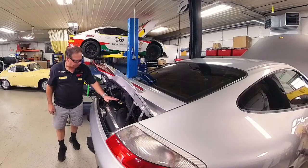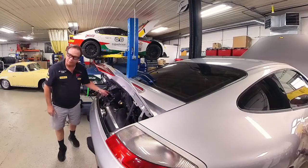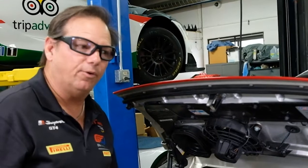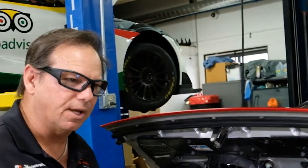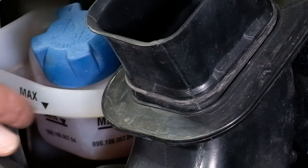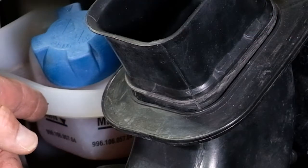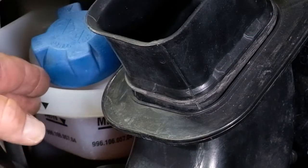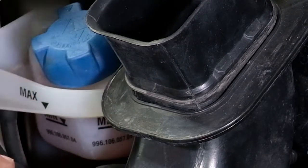When we're talking about plastics — the oil filler, the spark plug tubes, all the rubber and plastic materials — don't forget the cooling system. The water pump impeller is plastic. Do not replace it with a metal impeller because the metal impeller can do damage to the engine by sawing into the engine case. The coolant reservoir is also plastic. You notice how nice and white this one looks? As coolant tanks get older they yellow, and cracks form on the sides. The coolant cap also needs to be in good condition and not leaking.